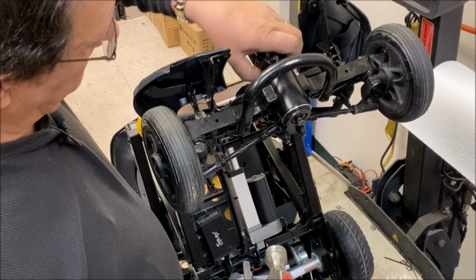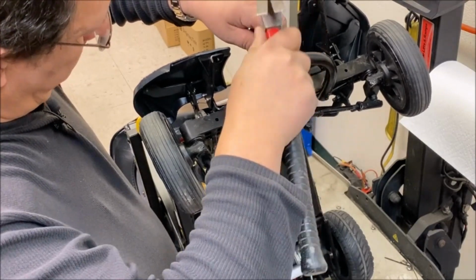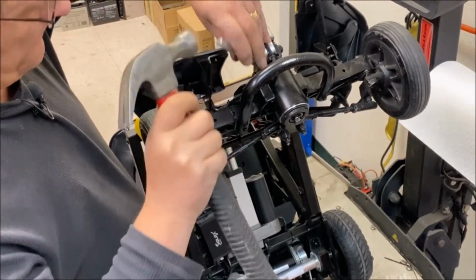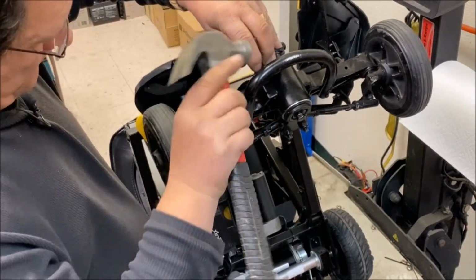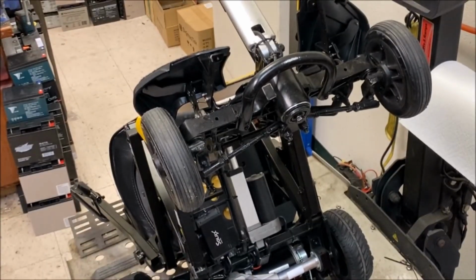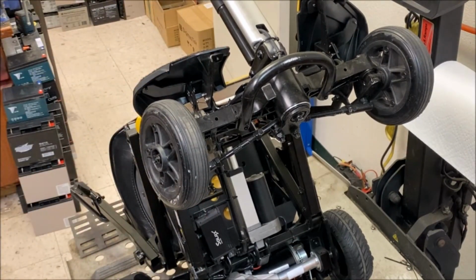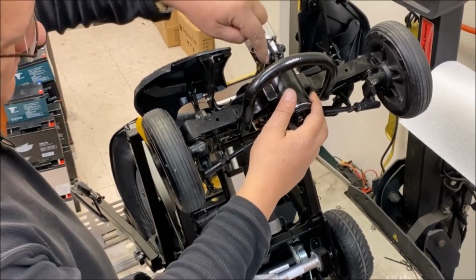And then this is going to be your lock nut to lock it all together. So the way to do it, same as on your bicycle: tighten up the top one, and then loosen up the bottom one to pinch them together, you're kind of going one forward, one backwards. And that should lock it together. Nice and tight. It'll probably come loose again. I mean, you could put thread lock on it, but I don't think you can get in to do it. But that should be, there's a little play in the frame, that's normal. But this shouldn't be loose.